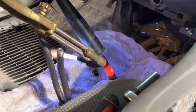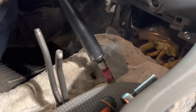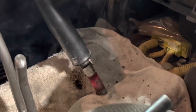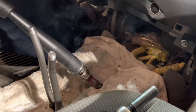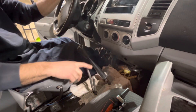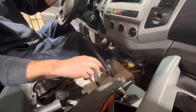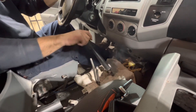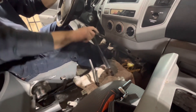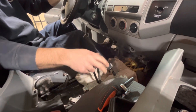Got a hole — let's start there. What we've done is heated the shifter up and bent it towards me slightly. That should be fine — just trying to give myself a little more room on the passenger side of the shifter. I think we're going to try and bend these towards the passenger side a little bit, and they need to be bent forward slightly. We need to make sure that we can go through all the gears but with clearance, and right now we're going to hit. So we've got to get these things bent over and up a little bit.